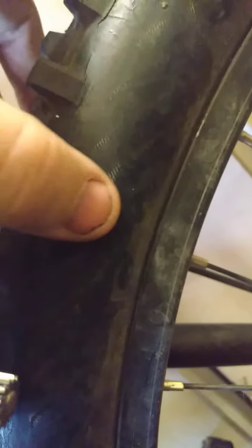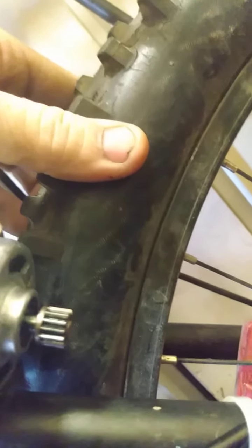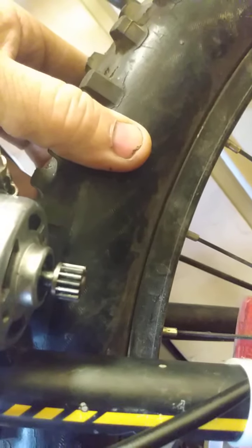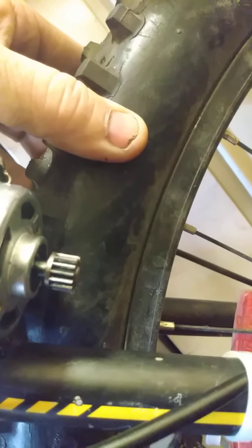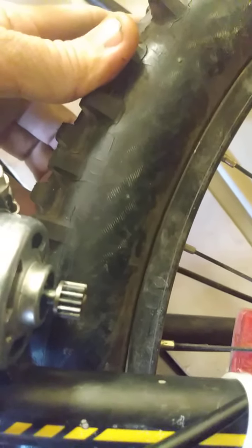Now if you're going to put it on the sidewall, you can see the marks on this sidewall where it's already worn thin. This was done before I got these tires — the previous user I bought them from had made mistakes and run them way too low on air. This is a 60-plus PSI capable tire and tube combo, and he was running them at the typical 32 to 45 PSI you would normally run an off-road tire on. These are not designed for that kind of PSI, and if you don't have them pumped up right, you will damage your sidewall — which this guy did.